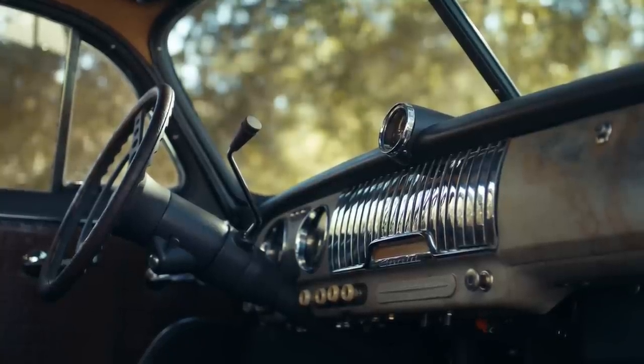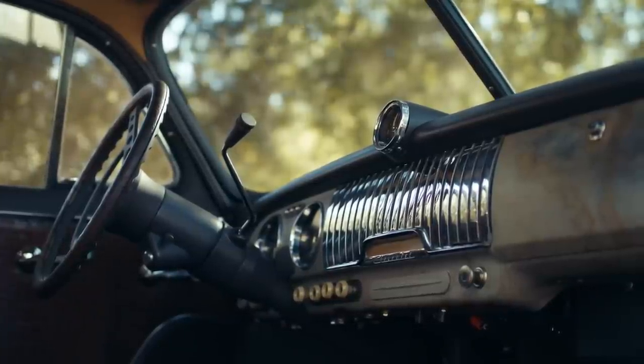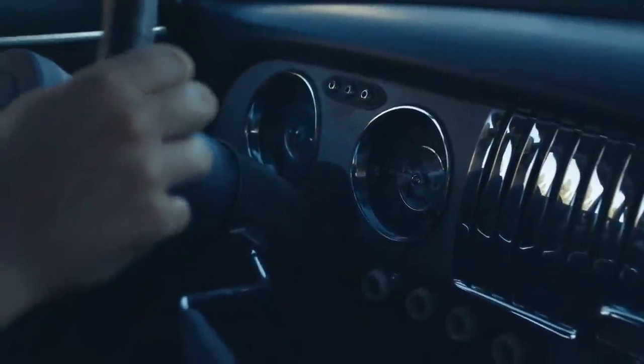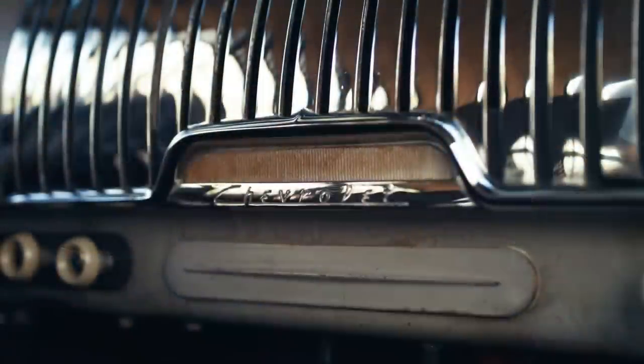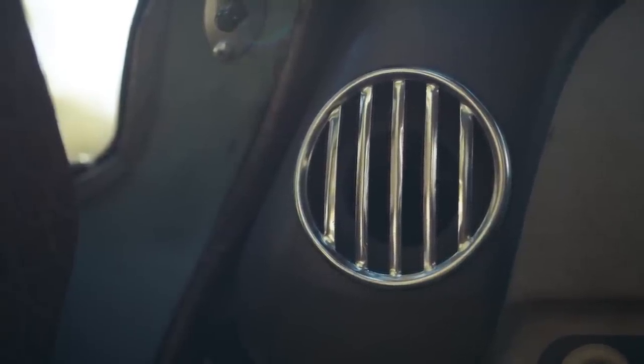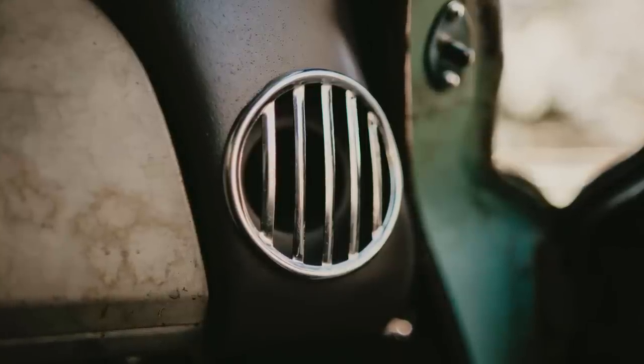The center dash and primary dash layout are all factory, and we modified that center speaker grille into the primary AC vents. It was tricky because of the compound curvature — CNCing or fabbing something for that surface was a bit nuts. I got lucky and scored some vintage Chris Craft bilge pump outlets — thin enough stainless that we massaged and reshaped them with a little heat, and those became the AC vents. Works really well. We rotated them so the slots run vertical, matching the vertical slots of the center dash.